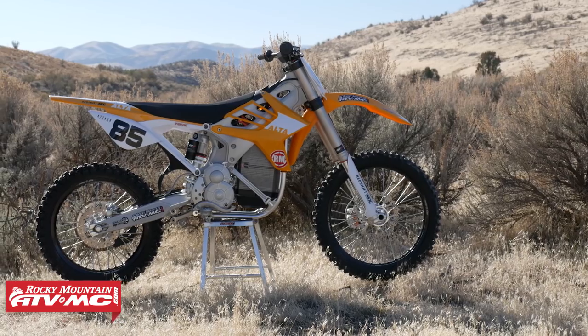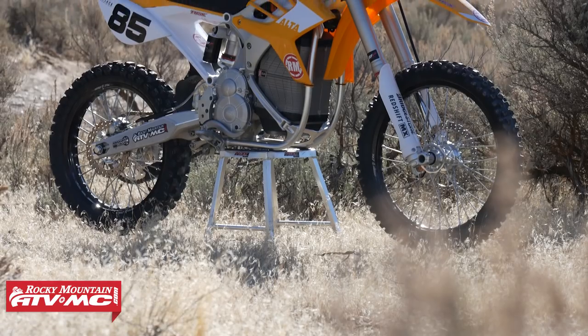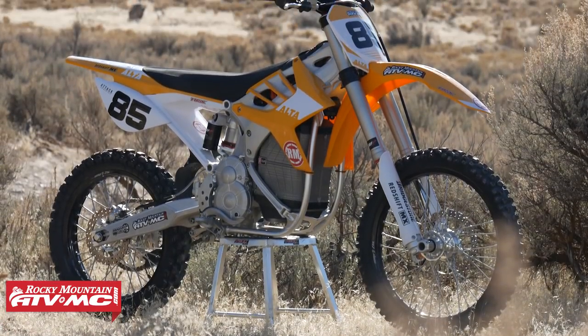Another pro is maintenance. It's very limited maintenance with these bikes. Obviously you have your wheels, bearings, and pivot points to service. But when it comes to the motor, because it is electric, you really only have two things to do. You have coolant in the motor, which you only need to replace about once every hundred hours — roughly once a year, whichever comes first. Alta does recommend a specific coolant for that. Aside from that, you have some oil in the gearbox that needs replacing, but that's really it. For riders who do regular maintenance on their motorcycles, you're probably going to save a lot of money down the road because there's just so little maintenance that needs to be done.